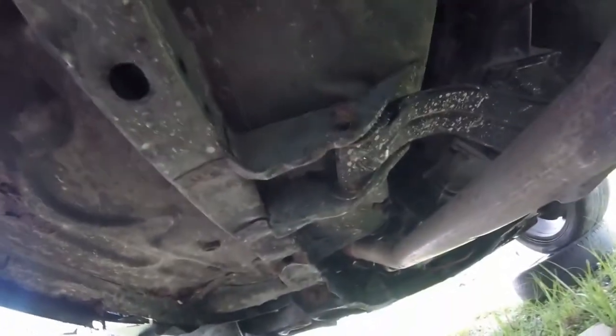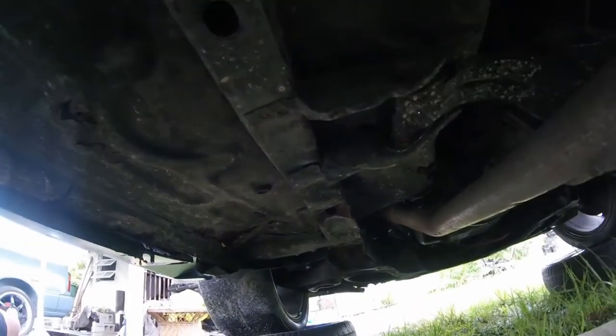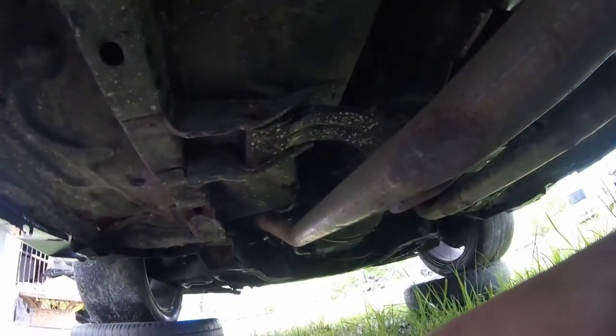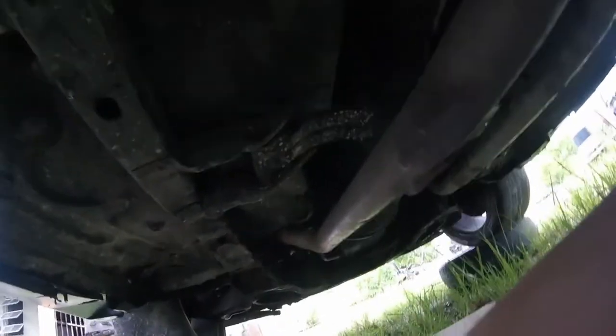But I have a crowbar, some simple hand tools here, and I'm going to start by taking this bolt out and trying my best to align this so I can get the bolt through the two sides. That should be all we have to do today to get the box to stop moving from left to right, because obviously with it sitting like this, this plate is flexing, which is why it's moving. So I'm going to take that bolt out and try to get it as best aligned in here, and then I'll come back and record the results.